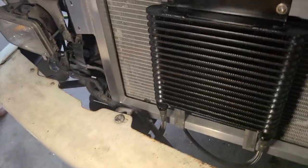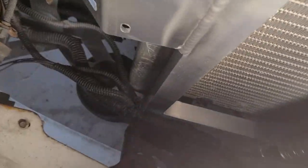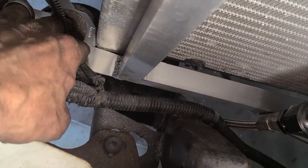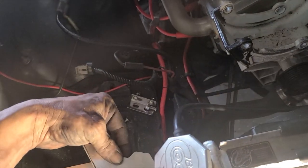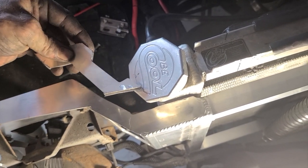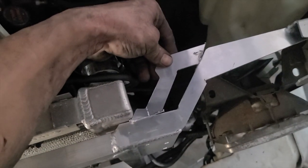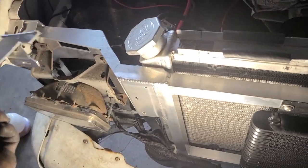It's kind of an overkill of bolts to hold these fenders on. I got that in and dropped the radiator down. I did have to trim — this is a bigger radiator, it's a Be Cool radiator — so I had to trim the bottom out to be able to push the radiator back where it wants to sit naturally. And then the top — this piece was farther over. As you can see, the radiator hits it a lot, so I trimmed both of them out to make room for it.